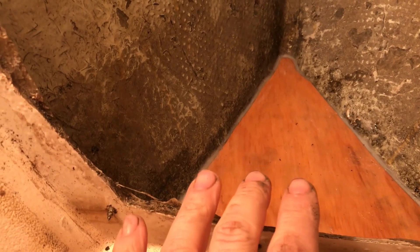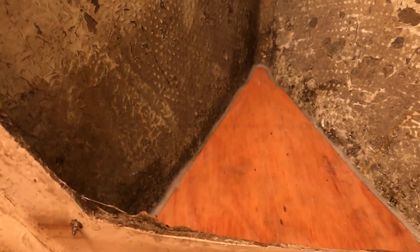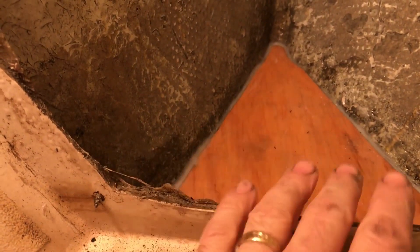I've also gotten rid of the hose that drains this locker. I've epoxied in a floor here — it's about two and a half inches from here and then probably another two inches once I bed the face back on. I'm going to glass this on, put a layer of fiberglass, and then lastly drill about a half inch or three-eighths inch hole with a clamshell drain on the outside. This is well above water level so there shouldn't be any problems.